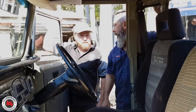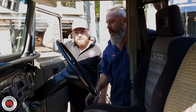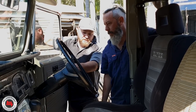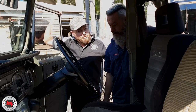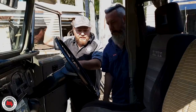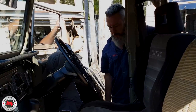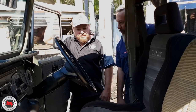It didn't have a dash pad so we've put a parcel tray up there — he can put his notes and what have you up there. Down here we've got some tails, because there's going to be a massive auxiliary fuel tank in the back — so we've got the tails for the fuel solenoid. And we've also got tails for air con, which he's having later on. You're definitely going to need air con.